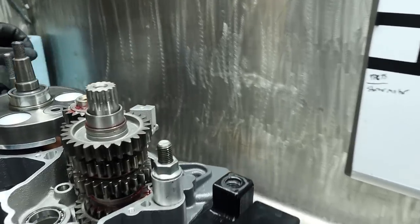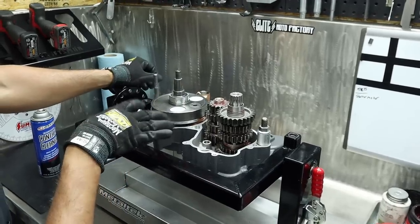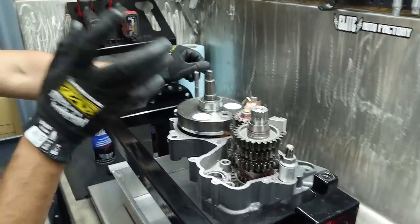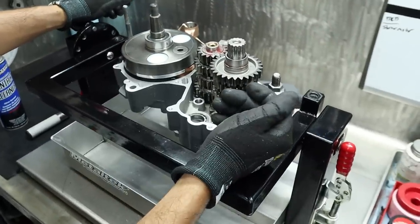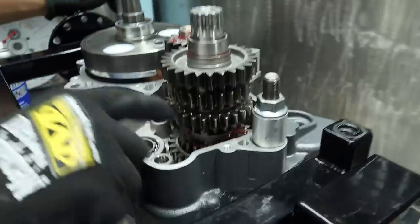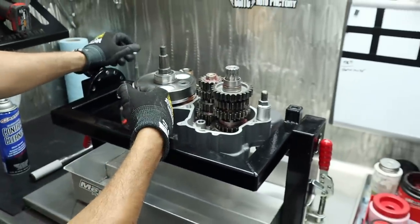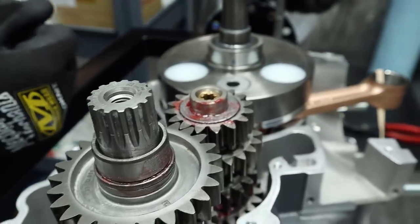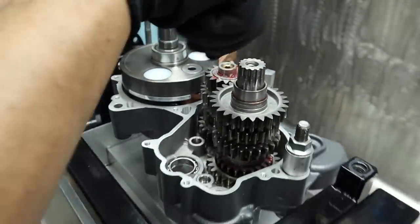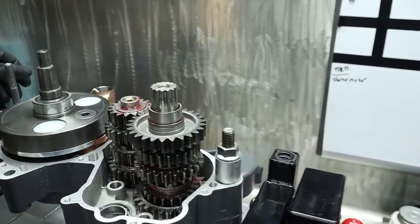I don't remember. Do you shoot any more stuff in there? This goes together like this. So dealing with a two-stroke, obviously we get our lubrication source for the engine from our fuel. The transmission already has some lubrication, and we'll obviously fill with oil, start it up, start cycling things. But until we start cycling things, the assembly grease, the transmission will be okay. Just for preventative measures, being that we didn't assemble the transmission with any sort of grease, we could take a little bit of oil and dribble it around the transmission. Roll it around, so at least it has some. They can go together dry and be okay.